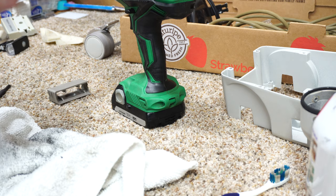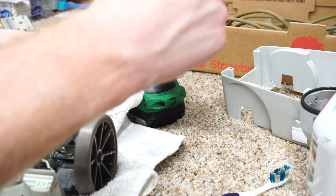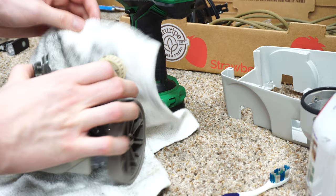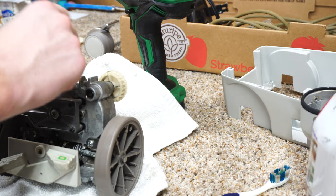Good - no cracks in that. This thing can get cracked. I do like to put just a drop of oil in that and in that, just to re-lubricate the needle bearings up there because they're accessible. And we're just going to take a Q-tip and clean any grease that was on the switch. I don't re-grease my switch pedals - they don't make any noise, there's no reason for it.